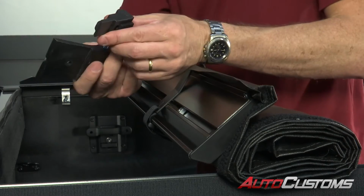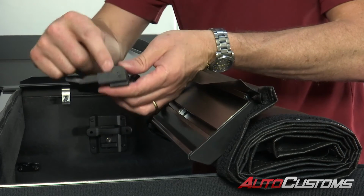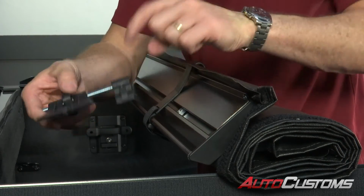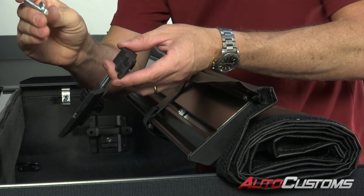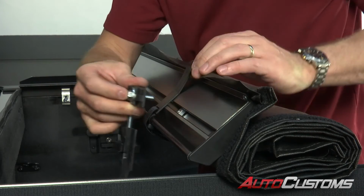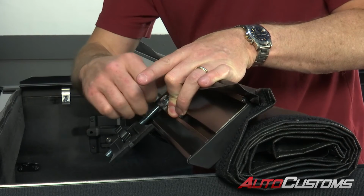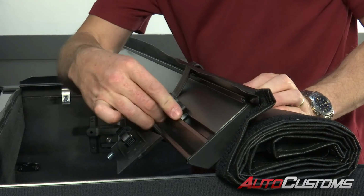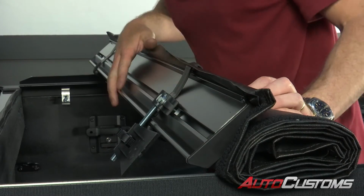So what I'm going to do is locate my tension adjuster for the driver's side over here. It's going to have an L for left stamped into it. This smaller portion, you got a hole in there. You're going to have also in your kit a long bolt along with a washer. You're going to run that through that hole, line it up to that square nut, and we're just going to get it run into the threads on that square nut. We want to be able to still slide that back and forth. Do that on both sides.